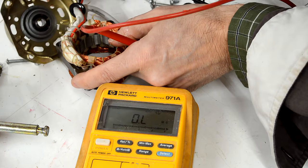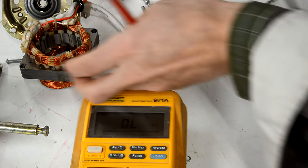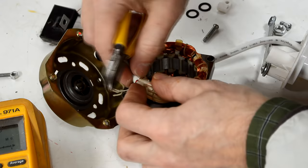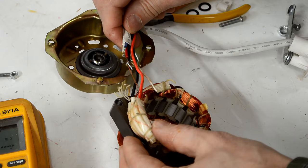It's possible that the wire just broke from all the oscillating back and forth, but I'm guessing there's a thermal fuse in here that's the problem. I was hoping I wouldn't have to get into here — this may not be worth trying to fix. And I just yanked the wires off and broke them.